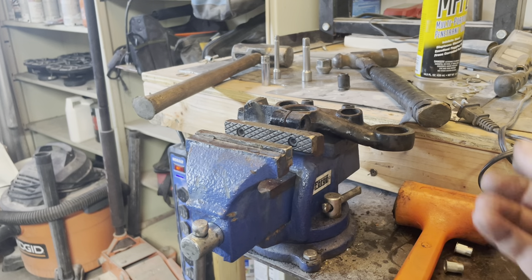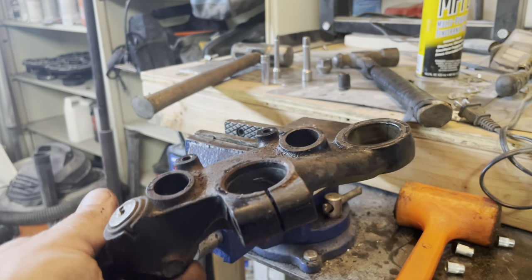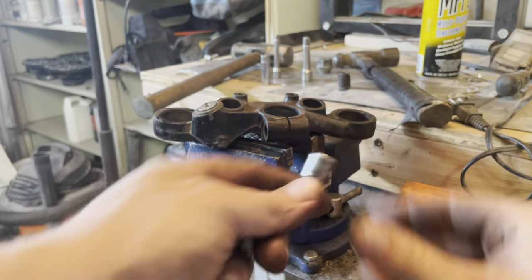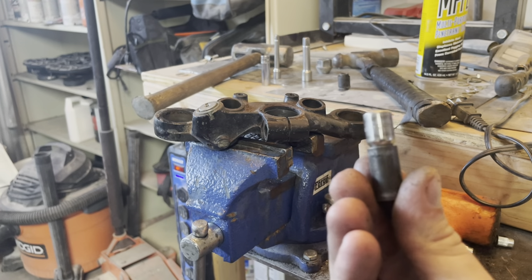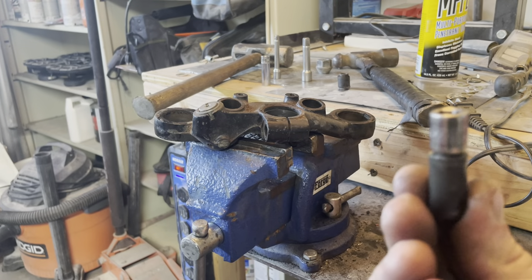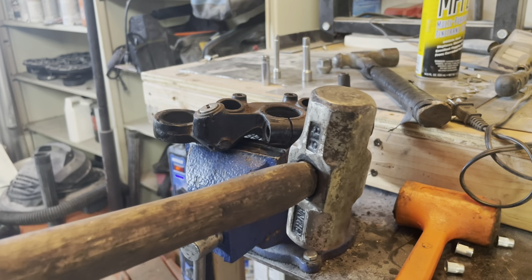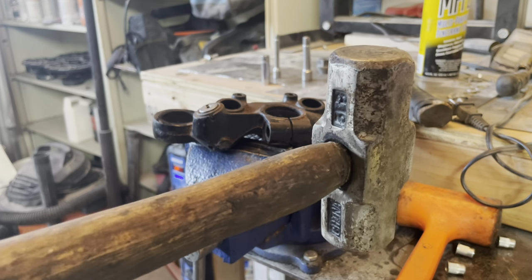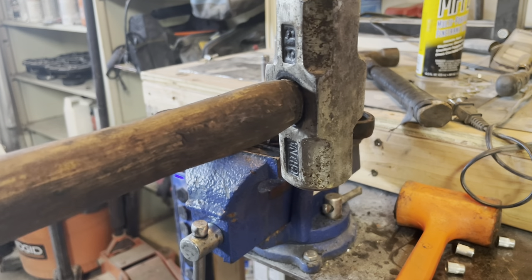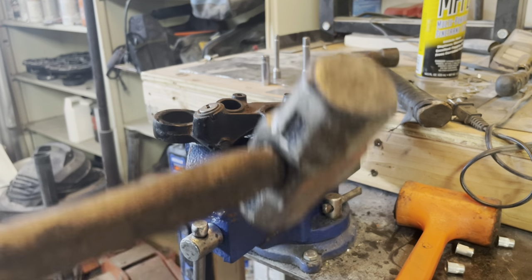Here are the main takeaways. As you saw in that video, I started with a reducer but quickly moved to an extension instead, because that worked better. This quarter-inch extension goes in here — this is the center part of that bushing, all apart because I ruined it — but it goes further in there and it's not going to bounce out when you start hitting it with the metal hammer. That's part two: a big, giant metal hammer. That ended up being the thing. The dead blow wasn't nearly as effective. I was mostly starting with the dead blow just so I wouldn't hurt my tools, but they're just Craftsman tools made out of metal, and it didn't really mar them up too much because this surface is smooth.